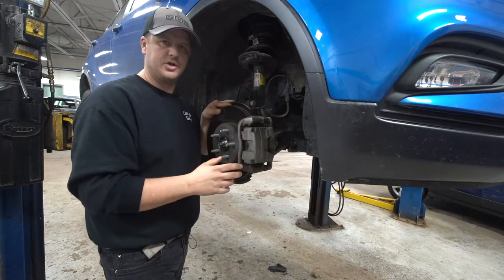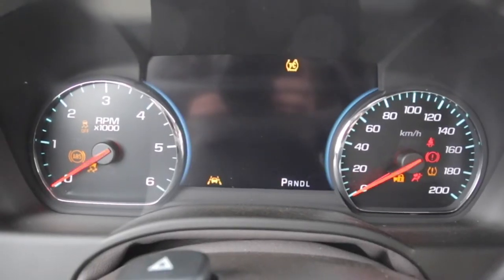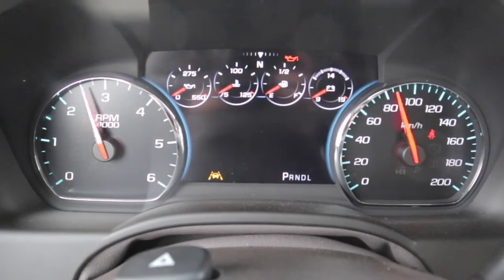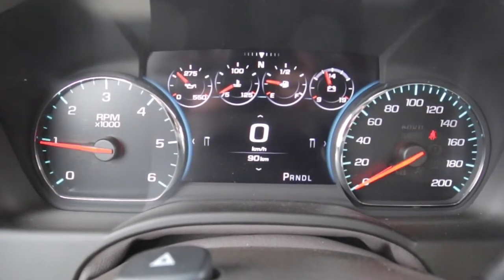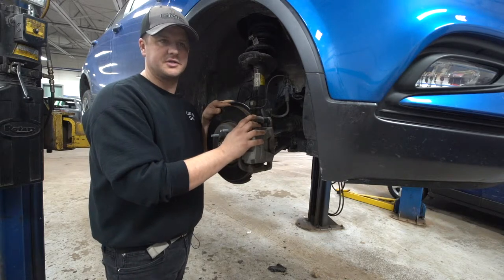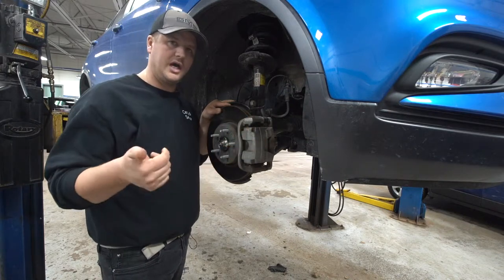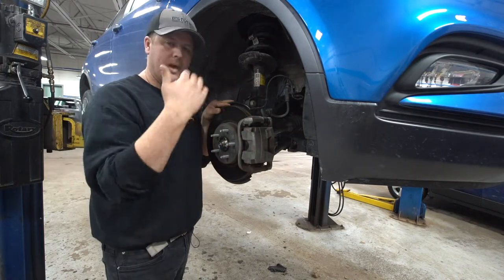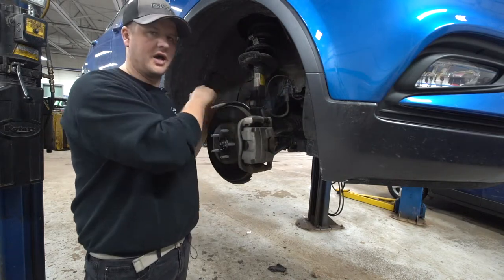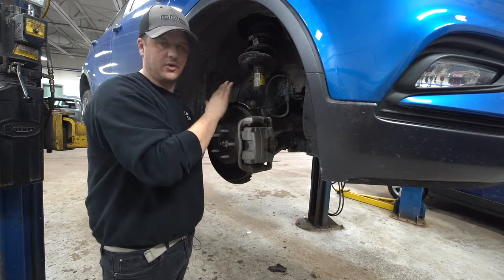Like a lot of other systems, many people don't know this: when you first turn your key to the on position and see all those lights illuminate on your dash, nine times out of ten that's the system performing a self-check. If you want to know if your ABS brakes are functioning properly, turn your key on — if the ABS light comes on and then goes out, the system is working normally. It's sent voltage out through all the lines, seen the expected voltage return, and knows everything's good.